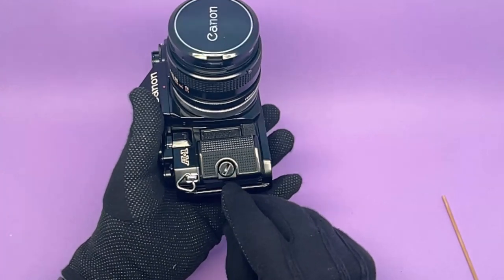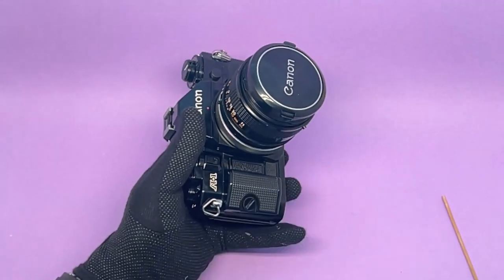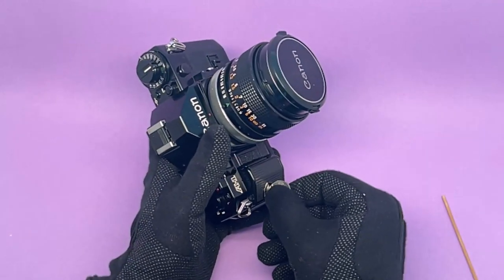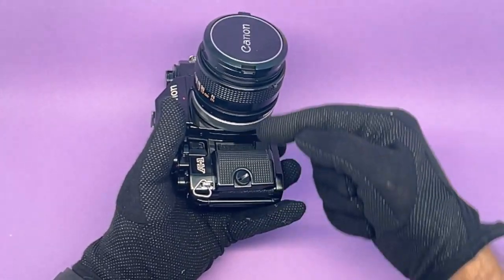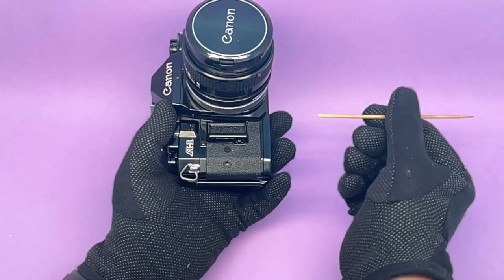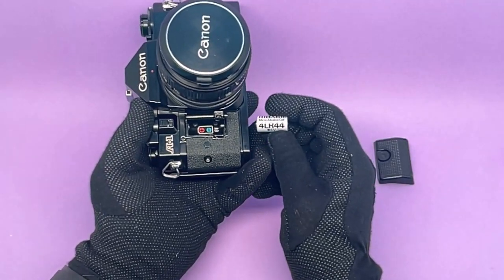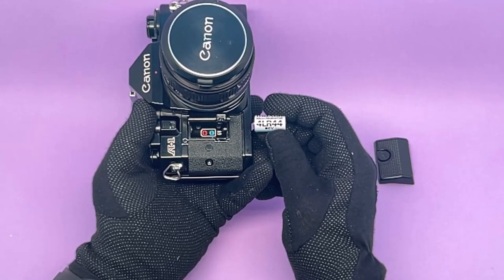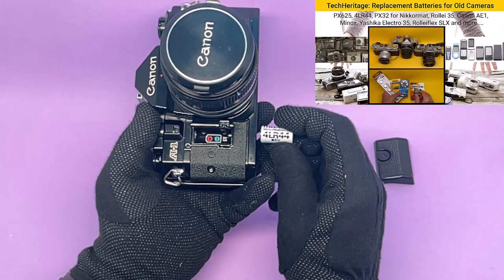On the right-hand side, there's an action grip which comes off. Using a hexagonal or octagonal coin — which is better than round ones — you unscrew it, slide it in that direction, and it slides off. Then use something like a kitchen skewer to press the little tab, and the battery compartment opens out. This camera uses four LR44 batteries. If you have trouble finding four LR44s, there's a modification video showing how to fit them in perfectly.